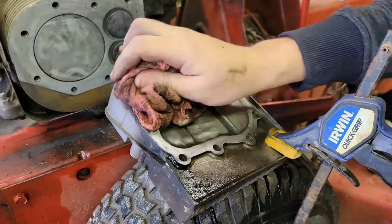So when you make a head gasket like this, it really doesn't need to be perfect, because whatever's on the inside will just burn, and then it's fine if there's some on the outside. I'm gonna cut this out now. Here's our head with all that head gasket. See, there's a really thin spot here, which I'm a little worried about, but I guess we'll see.